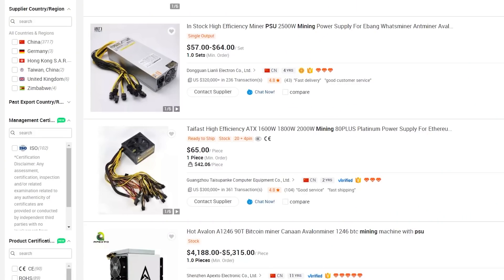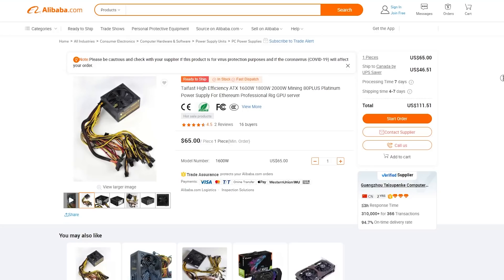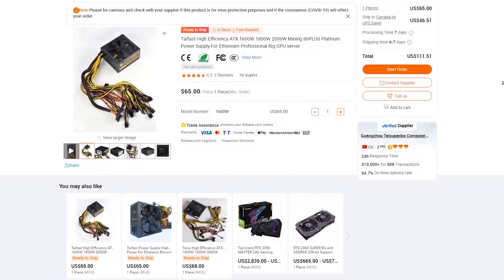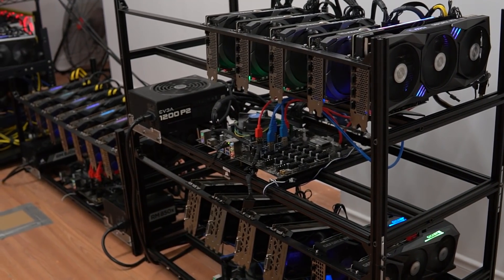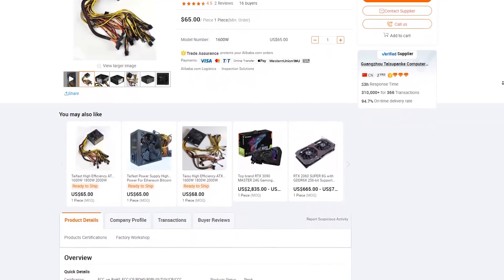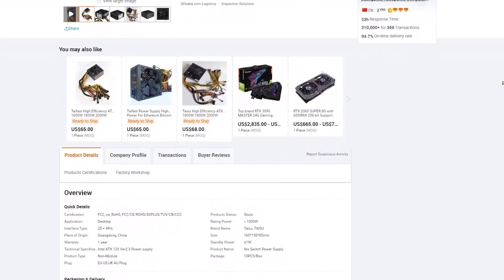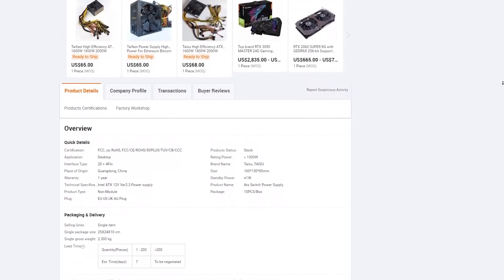Those Alibaba power supplies come in different styles — you have ones that are 1600 watts up to 2000 watts and they have a lot of PCIe cables, ranging anywhere from 4 6+2 pins to 12 6+2 pins, which is really good. Most of them run from 180 to 240 volts so you want to make sure you're careful on that. They are a good choice if you're planning on building a lot of mining rigs because they come cheap. But some cons are that sellers might require a minimum of 5 pieces and there's also a chance of getting bad power supplies. So the reliability part for Alibaba power supplies is not that good, but they're fairly cheap if you're trying to build a lot of mining rigs.